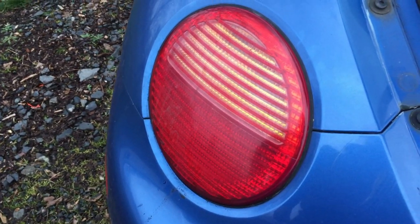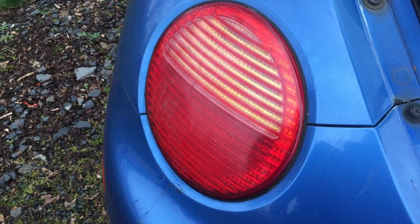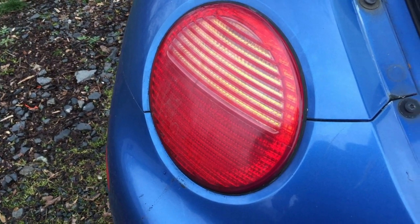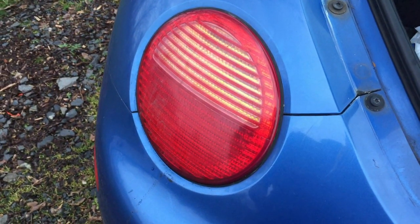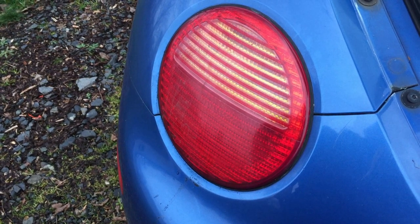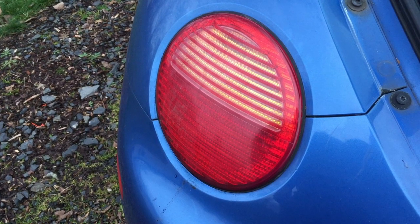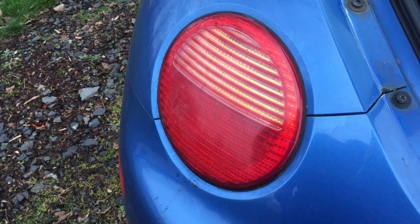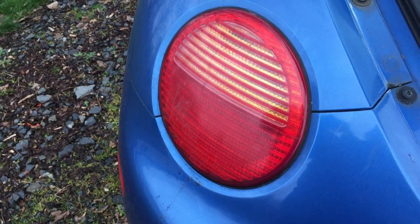Anyway, I was successful, obviously, in changing out the bulb that was burnt, but I decided to try to put an LED light in where the turn signal is, because it's not like the brake light. Well, LEDs don't work in this apparently, because the polarity is different. I'd have to cut the wires and switch them around to get the polarity right, so I just didn't want to go through that trouble, and I just installed the bulbs that came with it. And that's just an FYI.